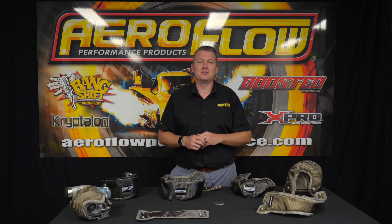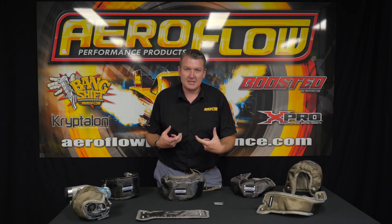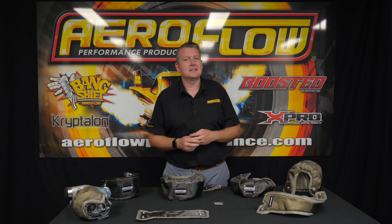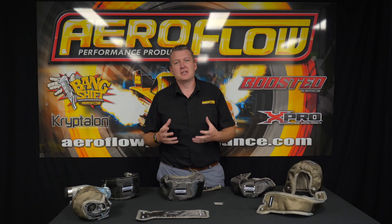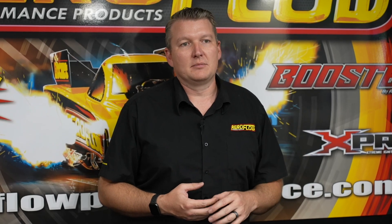We've got a whole range. Most people that are familiar with it will know that a turbocharger in an engine produces an extreme amount of heat. The downside of that is everything else around the turbocharger cops it pretty hard. So if you've got a fuel rail that's nearby, intercooler pipes, oil lines, paint, anything that's susceptible to extreme heat, you really want to protect that. One of the best ways to do that is to throw one of these turbo blankets on the rear housing — it's going to keep that heat in, away from those external components, and also keep the heat inside of the housing, inside the turbine, which in turn makes the turbocharger more efficient. The hot air carries a lot of energy and that's what drives the turbine wheel.